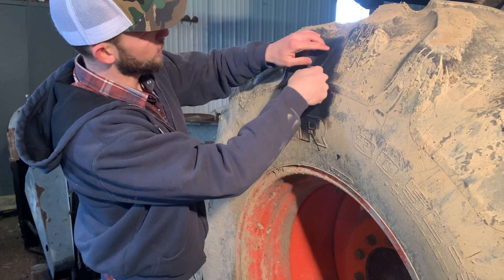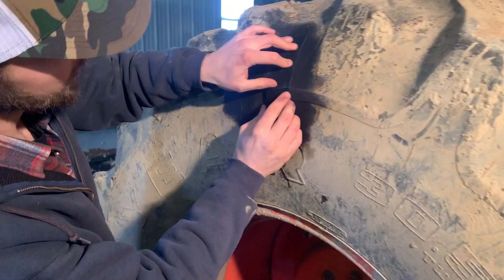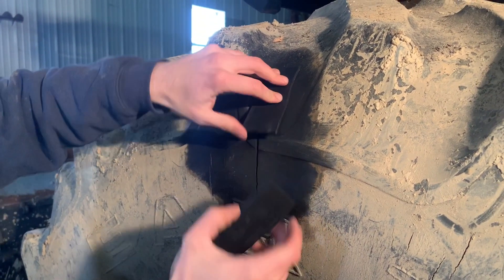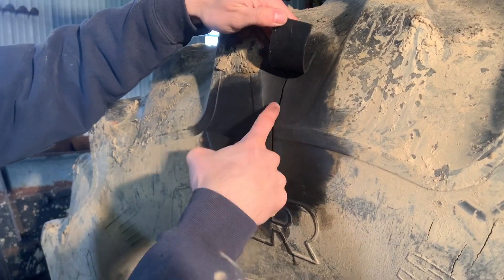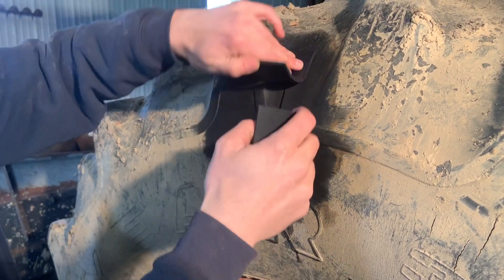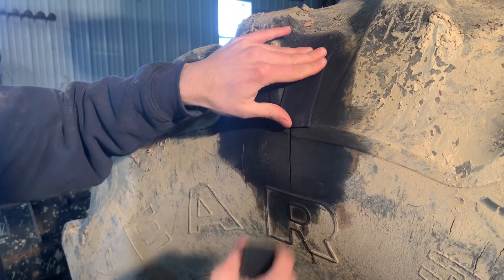You can see what we're going to do here — we'll have a top piece and a bottom piece, and we'll trim that again so it can fit. You do want to make sure you have at least a quarter of an inch on the outside of either side of the damage. We're going to have way more than that here, which will be really good to hold the tire for quite a while.